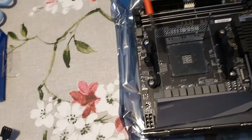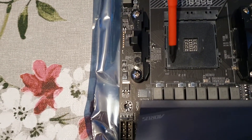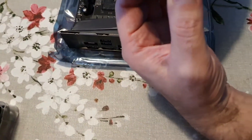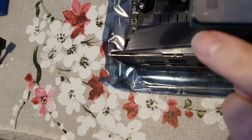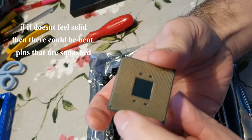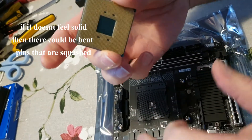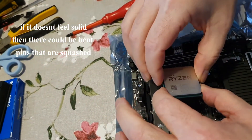There's a little triangle — you can just see it at this location here on the motherboard. We need to make sure the processor goes on the right way. On the front side of the processor you can see a very tiny triangle in that corner. If we flip it to the other side, you can see a bigger triangle there, and that's the triangle that needs to line up with the corner on the motherboard to make sure you've got it the right way around.